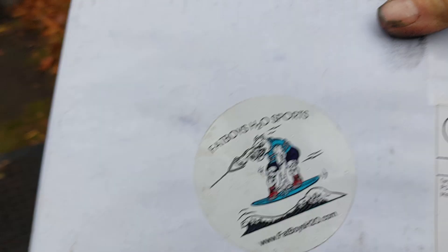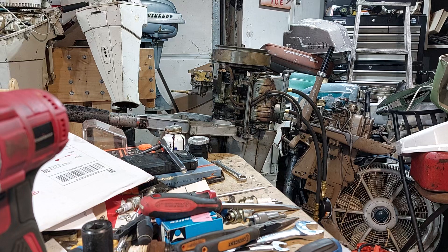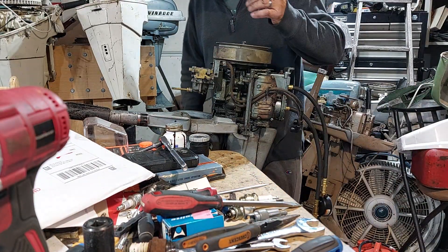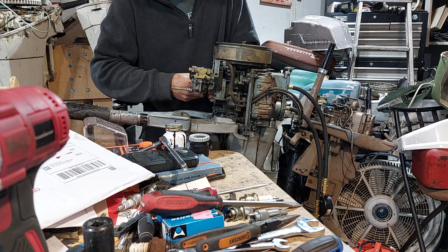There's my gasket - Fat Boy's H2O Sports. That is the base gasket for the 15 horse Seaking by Chrysler. I'm changing that lower pan over because when I got the $25 motor the bottom pan - actually called the support plate - was broke and water was getting up into the combustion area because it was cracked. Found one on eBay, been waiting for that gasket. That's the second time we got mail today - that's weird.